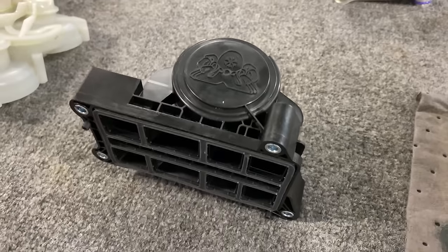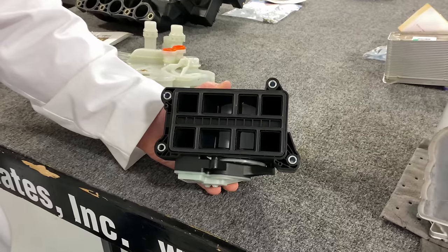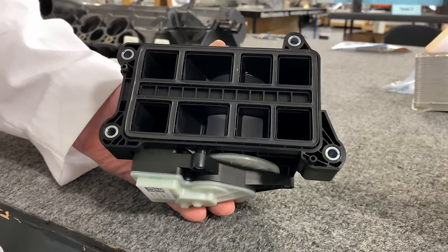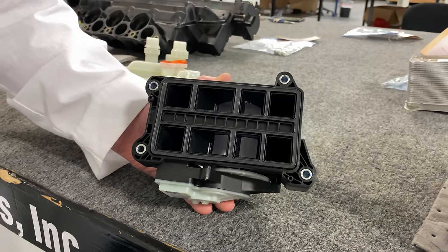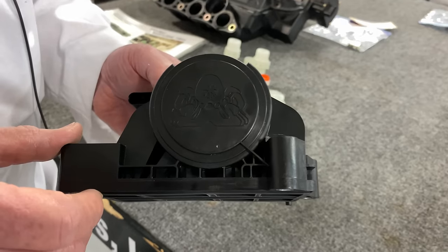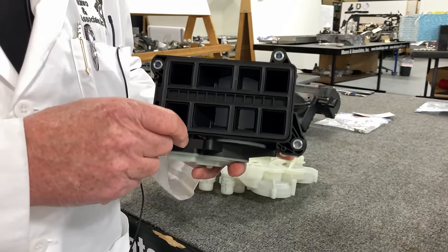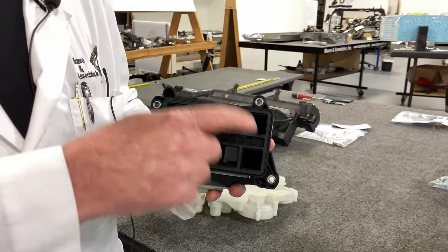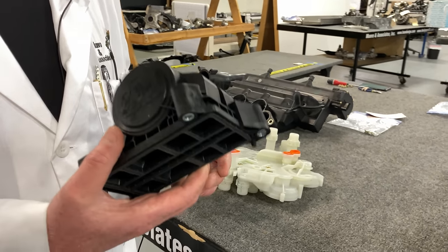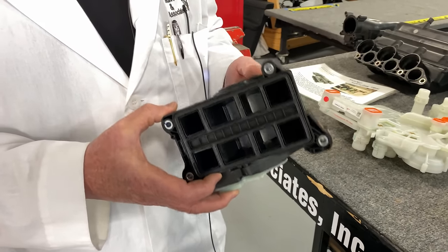Lost core could be done the same way here, but the volumes on this are much higher than on that V6 engine. Let's look at the octo valve itself. As you can see, it has eight channels, and those eight channels go to the various different opportunities we have to make sure all of the valves, bypass flow, and everything else is going in the right direction. Underneath the little emblem here is a four-position stepper motor that will move and shift depending on what load or action the coolant system is calling for. This little valve is genius — I really wish more people would look at how to take a whole bunch of functions and turn it into one.